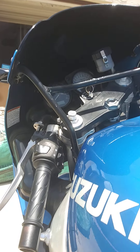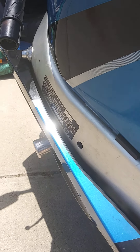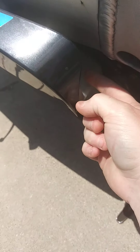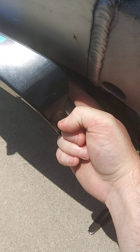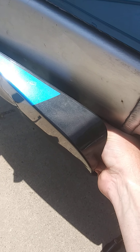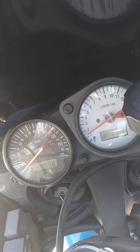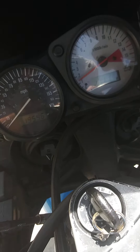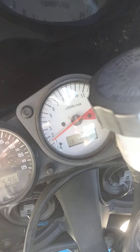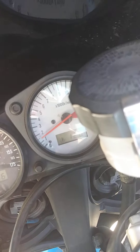The idle's kicking up as I'm turning it, and then I just turn it back down. It's got a Phillips screw head on it, so you can use a Phillips screwdriver. A good idle for this bike is about 1200 RPM — right there, that's a good idle. It usually runs at a good temperature of about 170 degrees while you're actually driving.